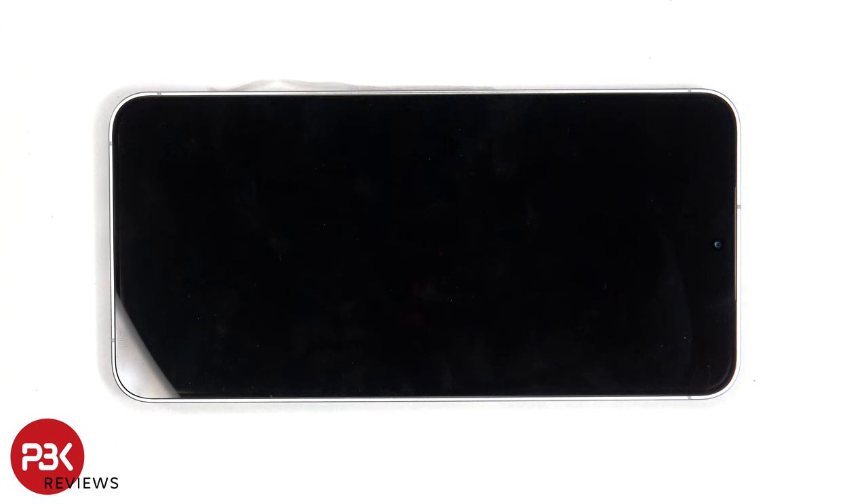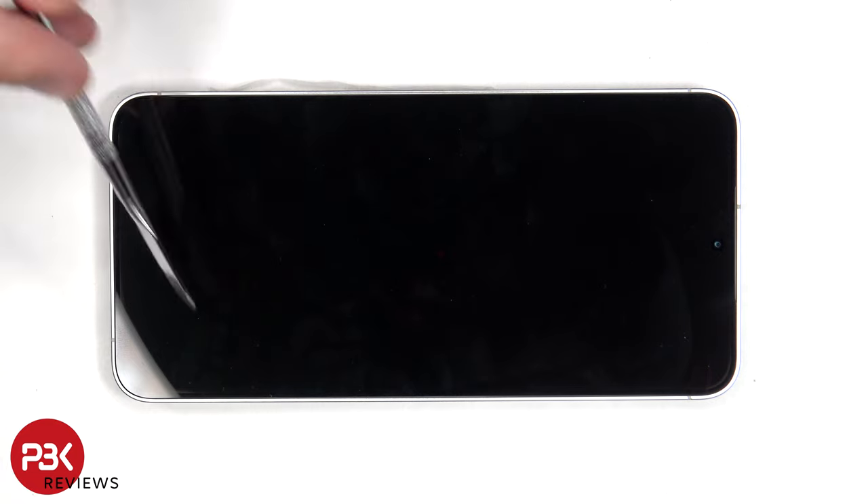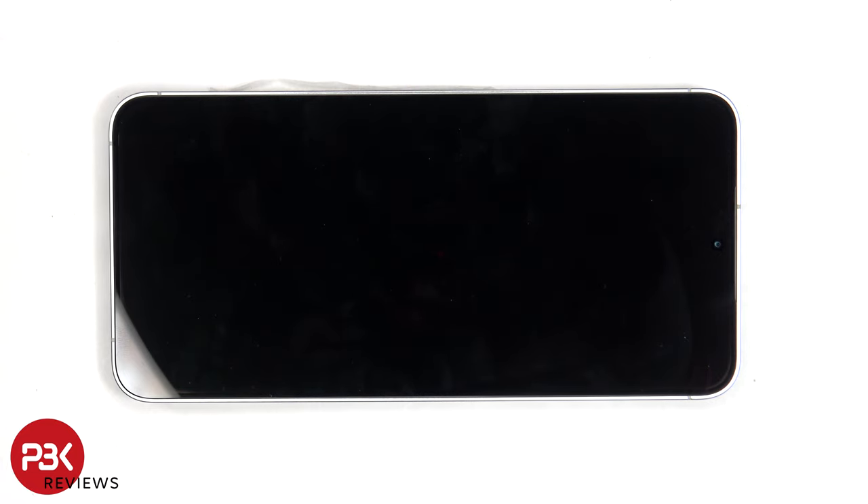When it comes to the screen, most screen replacements will come with the frame pre-attached, so the screen won't need to be pried off from the frame. If you needed to do so, you'd have to apply some heat to the screen to loosen up the adhesive underneath, and then pry the screen off from the frame once you've taken the back cover off and disconnected the cable for the screen. For these newer phones, since the bezel around the screen is so thin, they apply adhesive to the back of the screen directly and adhere it to the frame. Prying a working screen off almost guarantees damaging it, so I won't attempt to pry this working screen off.